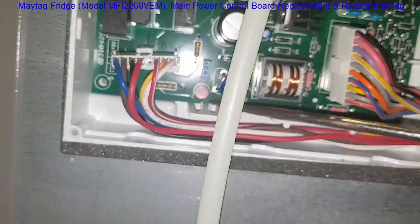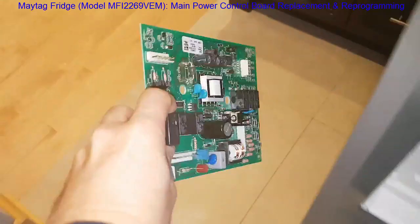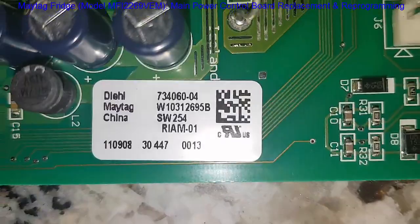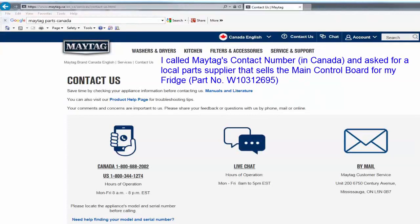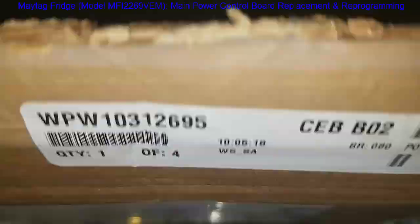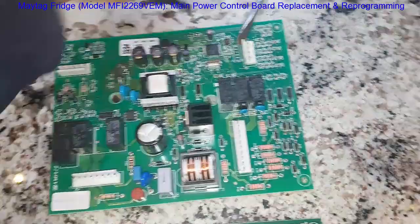Remove the clips by pressing the little tab and jiggling them off — get all four of those off; there's one up here with the tab at the bottom. That uncovers the board. Then you can use a screwdriver or your finger to press down and pull the board right out. Here's my old board — right here you'll see the part number. I searched online using that part number and found a company locally with a matching part. The new board is pretty much identical to the old one.